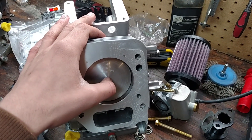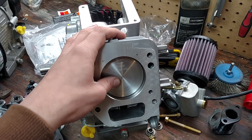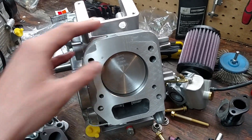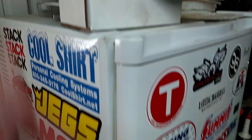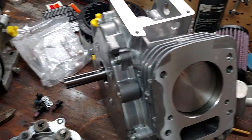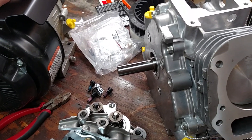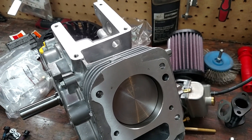All of these parts are available on those two websites I listed. The piston is the exact same size on the Animal and the Intech — I think that's about $60. A nice billet aluminum connecting rod is roughly $60. I've got one up in this box here that I just haven't put in yet. The cam was roughly $40. The valve springs are like $2 a piece.